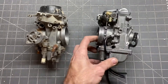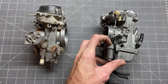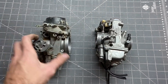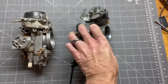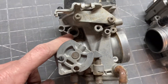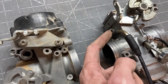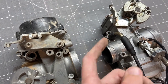There's also an accelerator pump — you can see this rod that comes down and pushes in here. There's a little diaphragm where it'll squirt a little extra fuel when you first twist the throttle — the stock carb didn't have anything like that. The choke plunger screws in on the original carb, and the flat slide carb uses the same exact style of choke mechanism, so I should be able to use the stock choke lever on the bar.